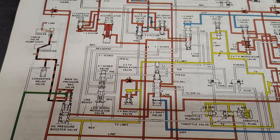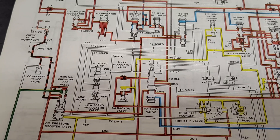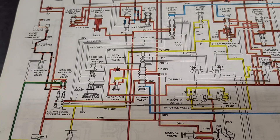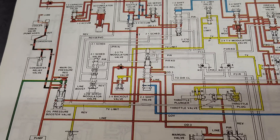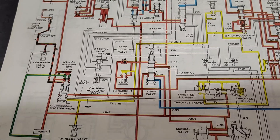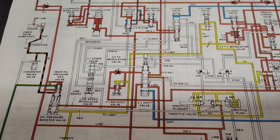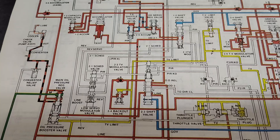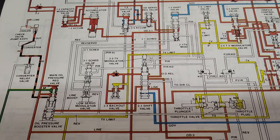I'm gonna get a little technical and then more simple. What is fixed pressure? The biggest misconception is people get under the impression that if it's fixed pressure, you don't really need the TV, or you don't really need to set the TV anymore. Well, that's absolutely false. You still have the TV thing to deal with. The only way you're gonna get out of properly adjusting your TV pressure is with a full manual valve body, which means it will not auto-shift. That's the only way. Other than that, you gotta set the TV, and you gotta set it properly.